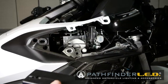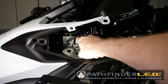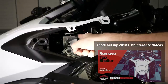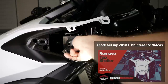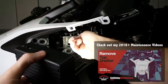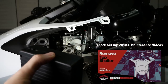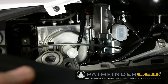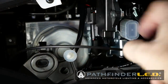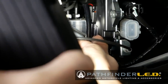Okay, there's another connector, a 2-pin connector back here, and it's on another one of those little stays, those little clips. And there's a tab on the back side that we have to get to release it. It comes up, and we need to get that released as well. I'm going to zoom in here so you can see it a little better. See this clip? This is the connector, and the little tab is going to be underneath. It's hard to get the light in there.